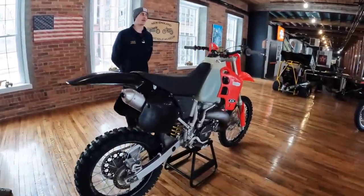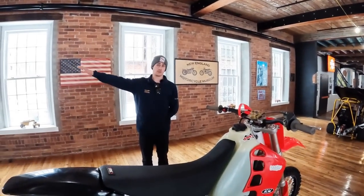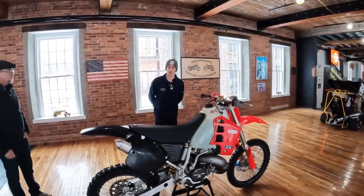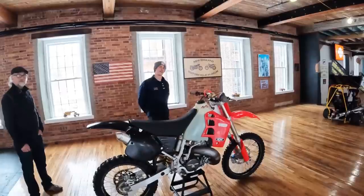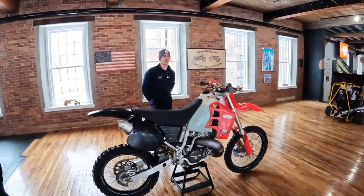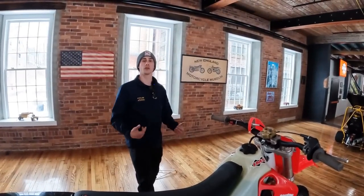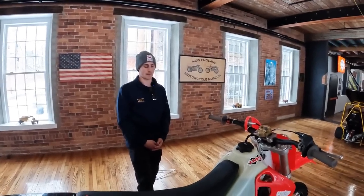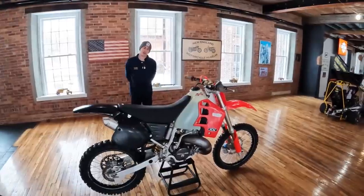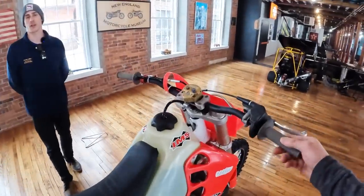I'm going to send it to Crank Works, and then have XPro right here in town press a Woessner rod onto the stock crank. I don't want to put a Hot Rods crank in it — personally I've had them grenade and I'm not a big fan. I've had bikes with 80 hours on a crank and it's fine, and bikes with 15 minutes on them where the crank locks up. We'll also probably put a Woessner piston in it, get the cylinder redone again for a fresh bore, maybe cut the head a little bit more, run C12, and keep everything OEM — nothing's better than stock if you want it to be reliable.